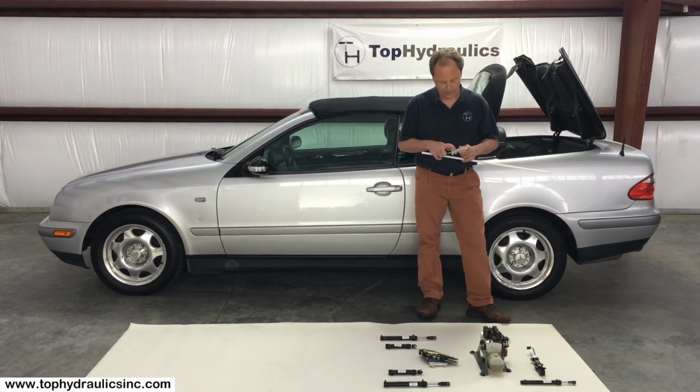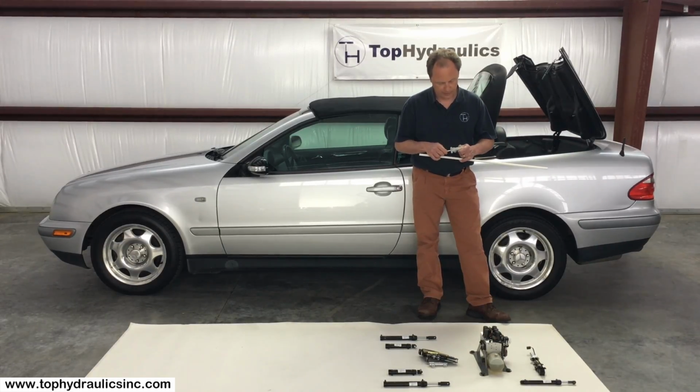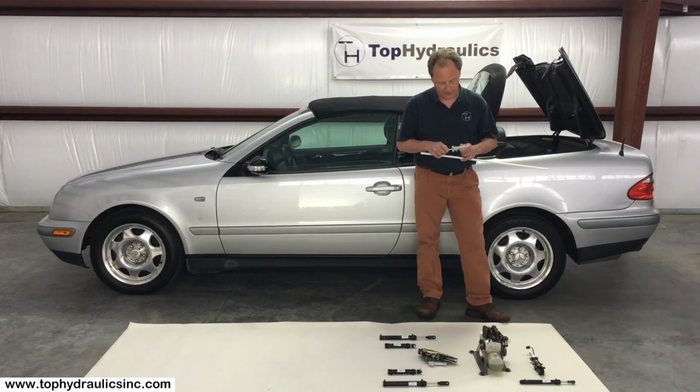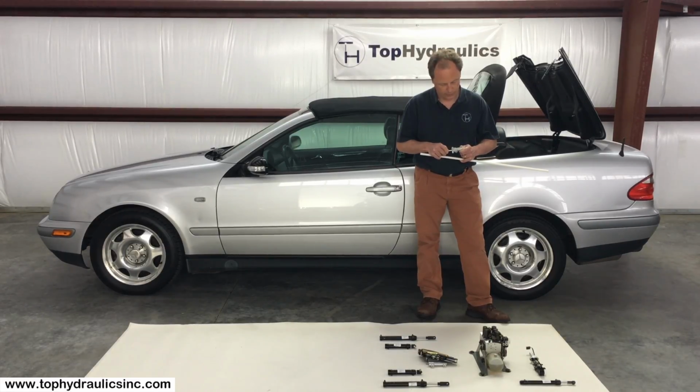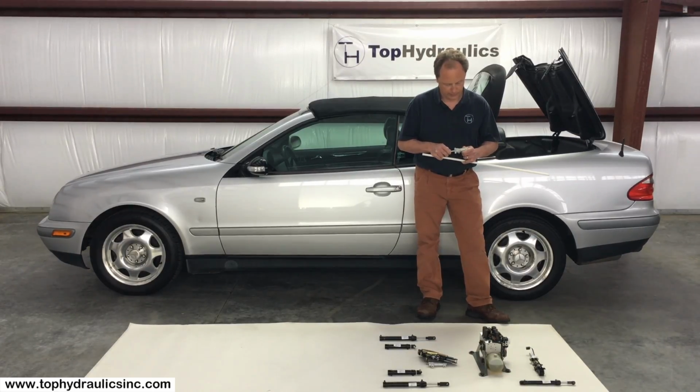There's the piston seal that separates the two chambers of the cylinder. Piston seals, when they fail, wreak havoc. They will plug up parts of your pump and also can slow down the rest of the system without you knowing what it really is, and your mechanic will likely say it's the pump while it actually was a piston seal.